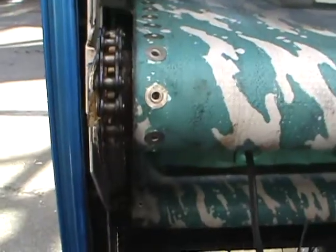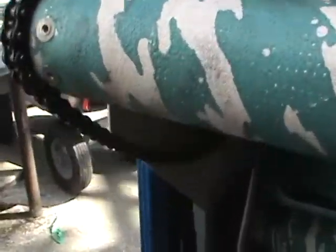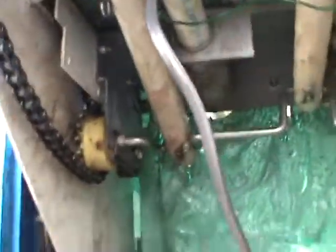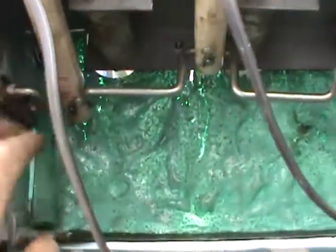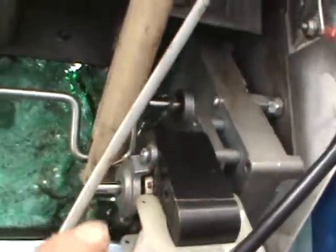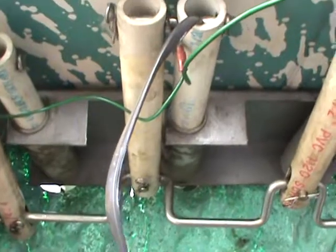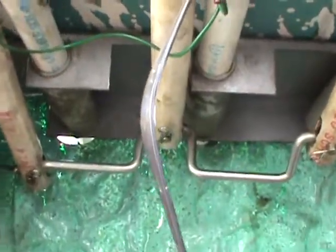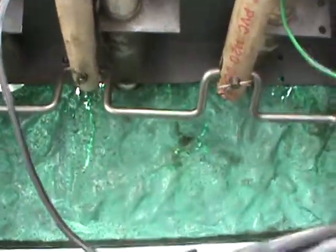Around here is the gear, and each tier has a tube here, and that's how each tier turns. Down here, this is the device. This is the cam arm. And there's the gearbox motor that drives this cam arm. And what does that do? Well, those characters you saw on the front, the cups, the surfers, the snakes, this is how they move back and forth. I'll fire it up shortly to show you. And while I'm here, I'll explain.